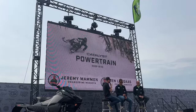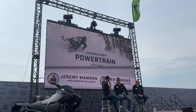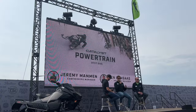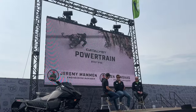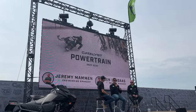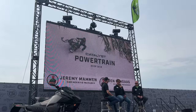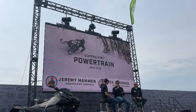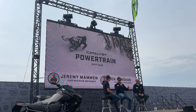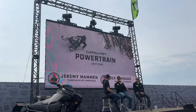When we talk about differences between the mountain, the Riot, and the trail Catalyst models, there are different gear ratios to suit the different segments. The mountain sled is geared down slightly compared to the crossover and trail. Positioning of the belt drive is also different between the mountain and the high performance segment — crossover and trail. We have a desired location for that drive shaft relative to each segment to get the ground clearance and attack angle we need. In the mountain segment it's similar to our Pro Cross chassis — that was the baseline. We then rotated the belt case about the driven shaft axis to get the same height and ground clearance needed for the high performance segment.